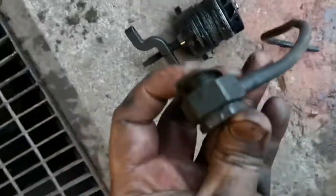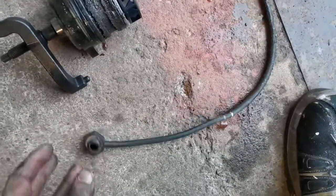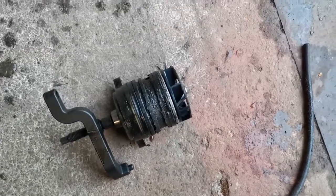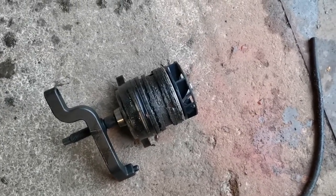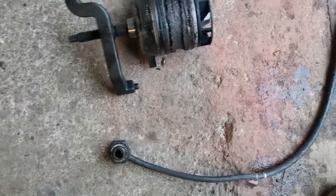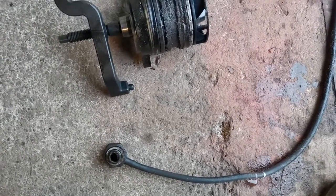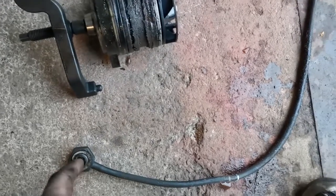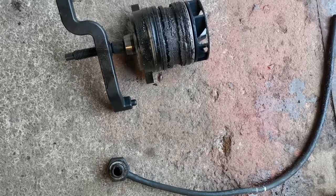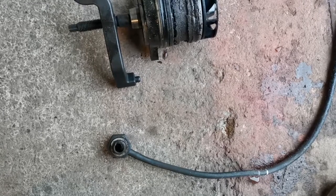That's why I recommend taking out this thing totally. It shouldn't come any water when you drive the car if the water pump and its seals are working like they should. On my car, when I took this out while driving, nothing came out, but when I stopped the car and the engine, a few drops of water started to come from that empty place where that thread is. Now I will change the water pump and see if the water stops coming totally.